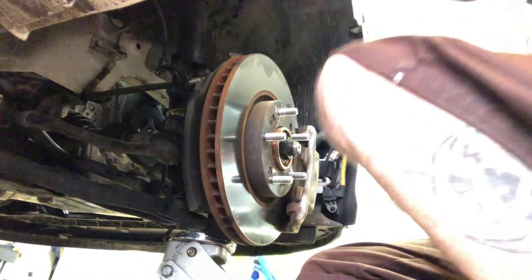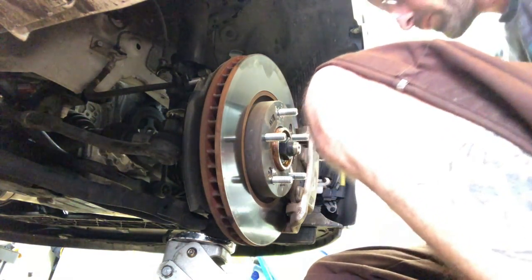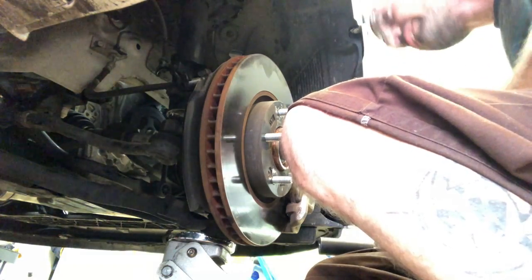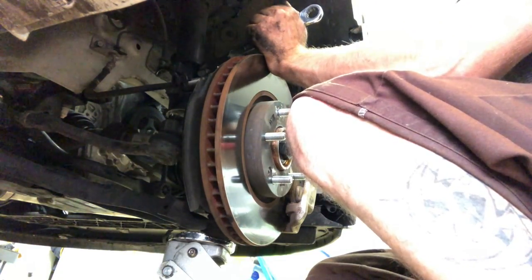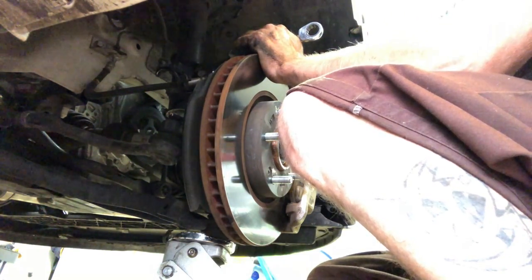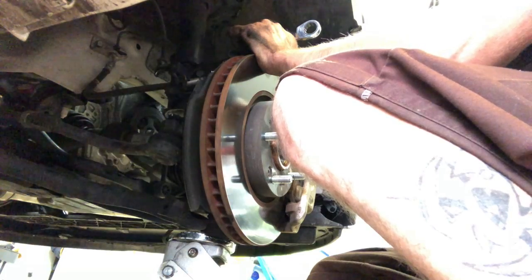And then to tighten the suspension, as some like to say, you gotta get a couple ugly lugs on there. If you don't know what an ugly lug is, I'm about to show you. Ready? My wrench. Now when you take these out, you gotta make sure you put this knuckle all the way against the strut, or make sure you take notes of how it's aligned, because this will ruin your alignment as far as camber goes. I set all of my camber in all the way, so that's what I'm gonna do on this one.